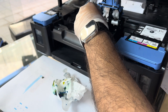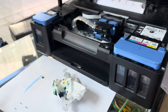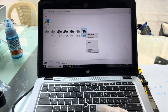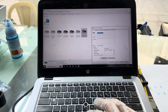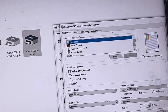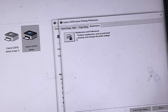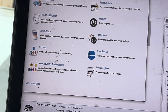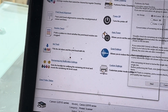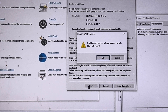Place it well, close this and this. Now on the computer screen I will do ink flush. I will go to Printing Preferences, then the Maintenance tab. You will see Ink Flush — I will do ink flush for all colors from here, and we will press Start and then press OK.